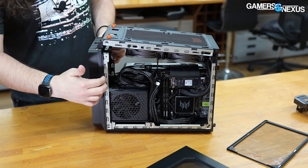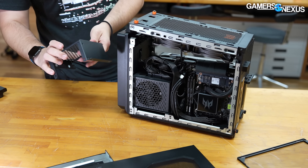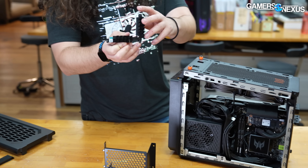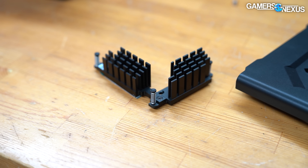There are a couple of 2.5 inch drive spots — one on the front, one on the bottom. The power supply has a bracket it can attach to. And you might have noticed there's a VRM heatsink that is missing in there — that's right here. We don't have a VRM spec; I've asked for one but don't have that right now. For a 13900KS to go in there it's got to be at the higher end, but there is a heatsink included at least.